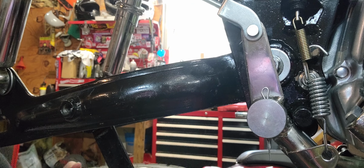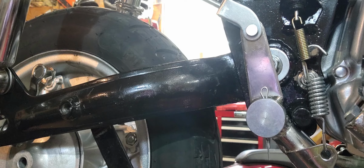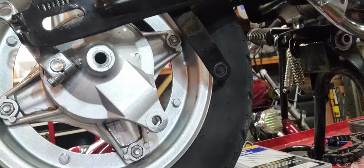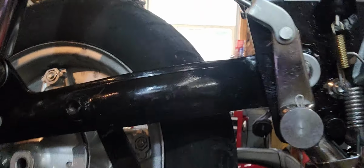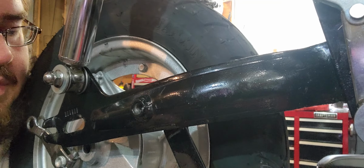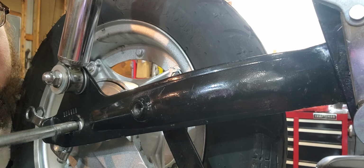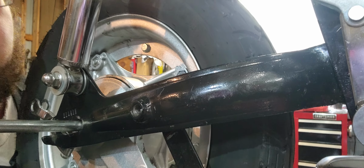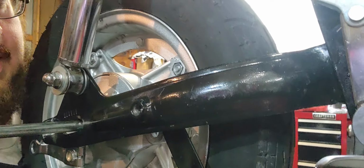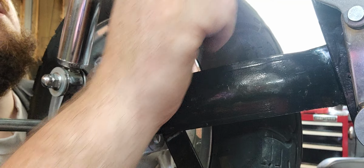Okay, I'll move you periodically through here. Take your wheel with your brake assembly in there. It'll be orientated about like that. We'll come back here in just a second and I'll show you more. So, spacer. Just kind of push it up against the control arm. Don't force it. You don't want to force your axle. Just nice, shaky left and right. Oh, darn arm, getting in my way.